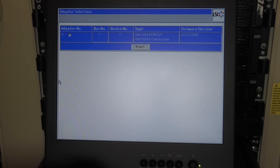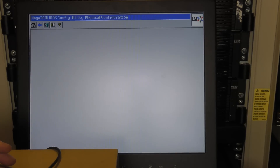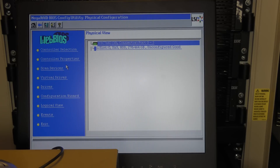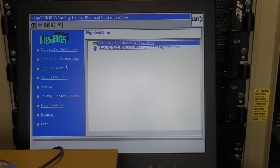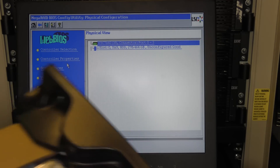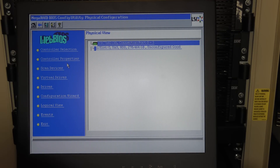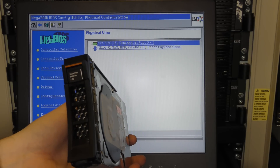Web BIOS will execute, and we are in — except the mouse doesn't work. An external mouse is installed, so let's press Start. It sees my 300 GB unconfigured good disk right there — that's awesome. It's connected to port 0 to 3, so that's the first port, which should be good. As for my mouse pad here: that's the disk I want to try — a 3 TB drive taken out of a Lenovo x3650 model 4 where it did not work. I want to see if I can put that in here.